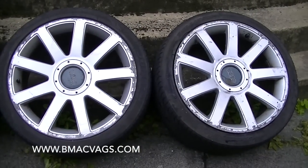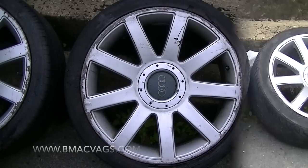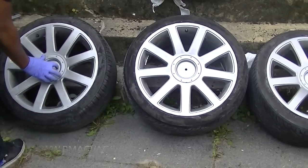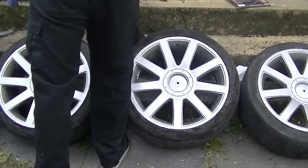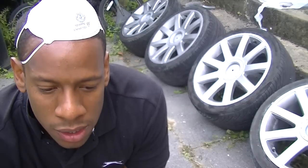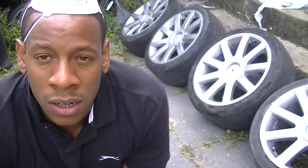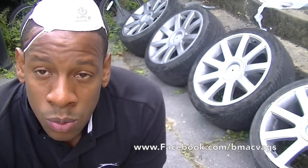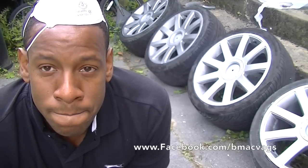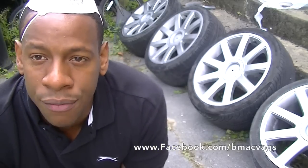Just as a reminder, here's what the wheels were like before - scraped up, peeling, really not in good condition. With a little bit of work they come up really nice, clean and tidy. The camera doesn't really capture how well they came out but they really did a good job for such little labor. Now a couple of important points: number one - preparation. Make sure you sand it very, very well or you will still have imperfections showing up in your paint.